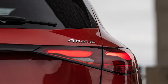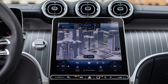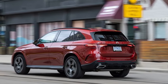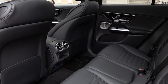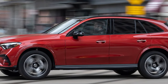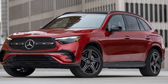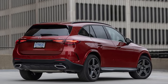That Rubenesque contact patch helps explain the improved skid pad figure of 0.88G, besting the old GLC's 0.85G — not that impressive when accounting for the transition from all-season to summer tyres. Mercedes's tweaks boost EPA estimated highway economy to 31 miles per gallon, 3 mpg more than the outgoing model. The GLC 300's newfound electrification also sweetens the SUV's on-road demeanor. The stop-start is among the smoothest on the market, reviving the gas engine with nary a shudder. Under deceleration, it's difficult to notice when the engine shuts off for low-speed coasting. The remaining driving experience would be best summed up as sport-adjacent — standard adaptive dampers keep things smooth over mildly uneven road, and body motions are well controlled, but more dramatic bumps transfer motion inside. If ordering our own GLC 300, we'd stick with the standard 18-inch wheels with thicker sidewalls for a better ride on Michigan's roads.